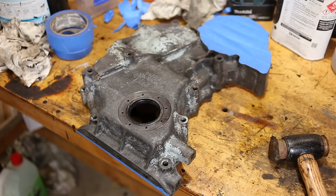Now I can see that this is too thick, but we'll give it a go as is and adjust from there next time. Typically I expect paint to have the viscosity of milk, thicker than water, but certainly thinner than cream. And as expected, it didn't spray well, more spit. But usable. Usable enough that I didn't bother doing anything about it, but next time I will thin it down more.